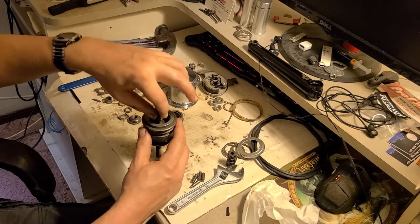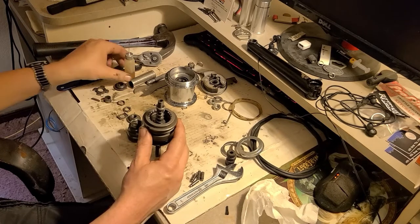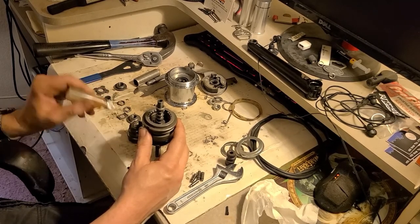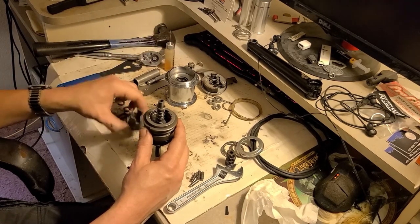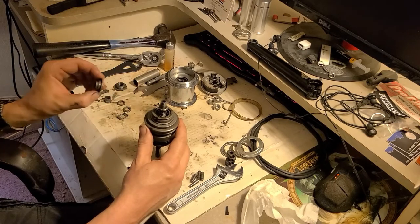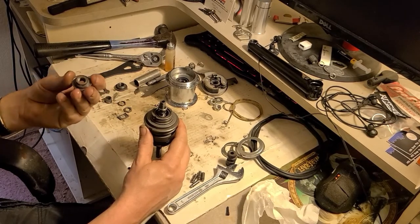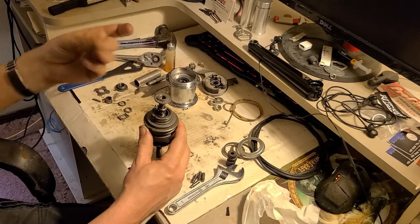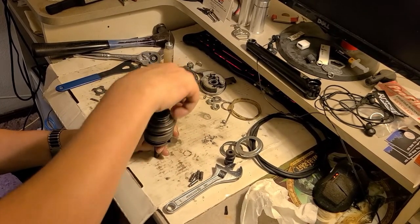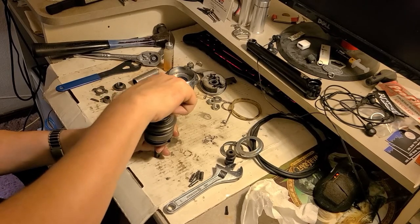We have this spring — that doesn't really need anything. Get that cat hair off there — we'll get the spring on there. And then we have this driver. We'll put oil where the clutch sits. Some guys like grease in this little slot, but there's grease in the bearings — I kind of find that grease in the slot just holds dirt. So we'll just not worry about that. I usually don't have an issue with water contamination and the oil just comes out anyway. I just don't want to get it on the brake side.